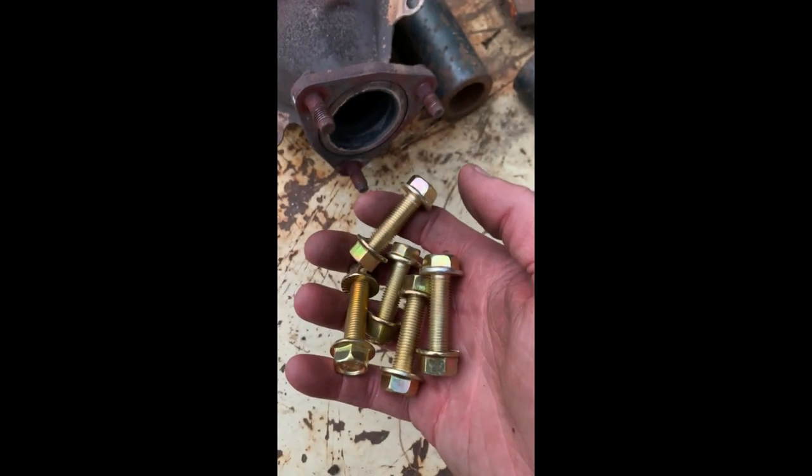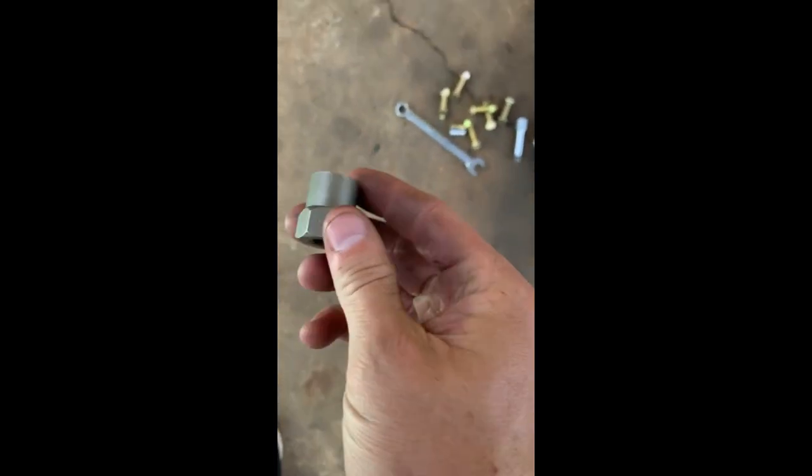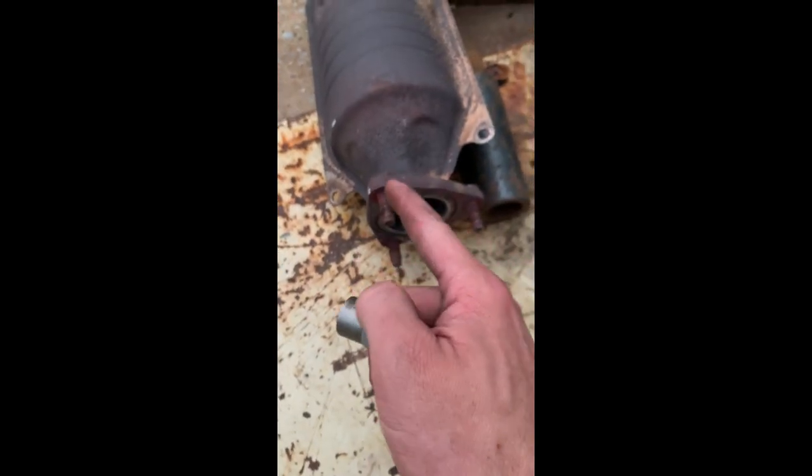I went to Advance, got the right kind of bolts, and I was able to pry off two of these nuts at my house and figure out what size I would need. And that's how I know I sized these correctly. This tool — it's an Irwin adapter and you hammer it on. It hammered onto the end of the nut because these are all rounded off. I spent four hours underneath my car today. So with the old nut on, you hammer that on and then we were able to just break it free. The guys at Advance were super nice.